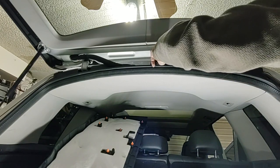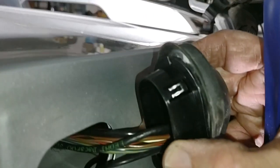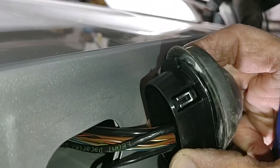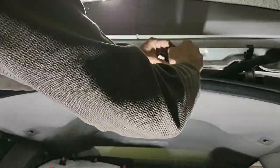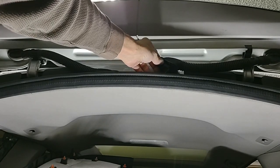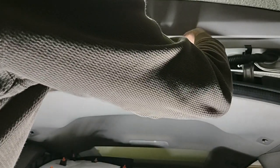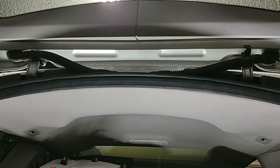Now I'm going to connect the bellows back in its housing. The way to do that is to access these little clips — they get pushed in from the side — and by pushing in that clip you can pop out this little tube and connect it back to the rubber hose, because otherwise you'll never get it on. Definitely a two-handed job. The clip is now fully surrounded by the rubber, pushed in, and it's good as new. Now let's get the rest of this wire routed into the tailgate.